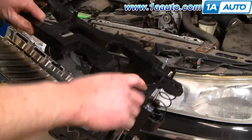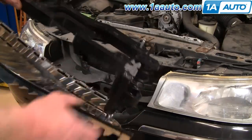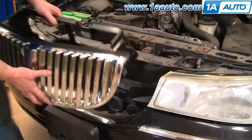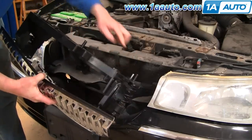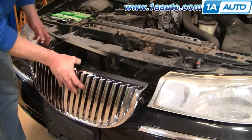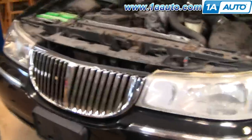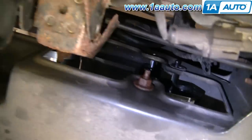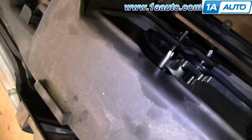Because of that, what I've done is take the stud out of my new grille. Installing the new grille is pretty much the same. It has these longer locating tabs on it, so you can kind of put it into place. On the back side, you can see I've got the locating tab through down there, and then the locating tab down here, and then my studs have come through.